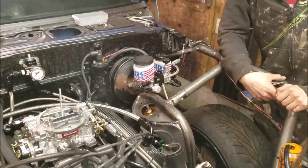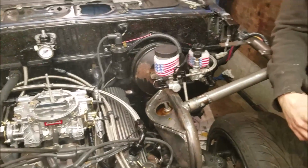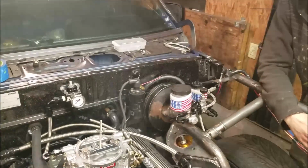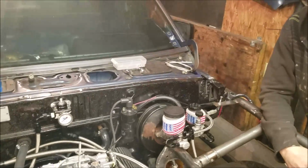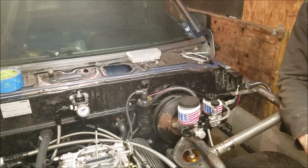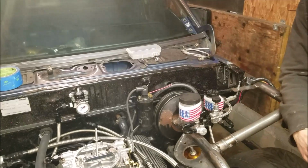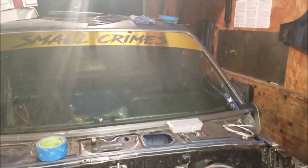When the coil blew up, all that oil went right on the header, and that's why it's burning our eyes, because it is oil. Oh shit. Awesome. So if you leave your key on and you don't have capacitive discharge or whatever I said, it's too late to even remember what it's actually called. But you leave 12 volts on your coil, it's just a giant heat sink deal, and it just goes boom. Ticking time bomb. Pretty much.